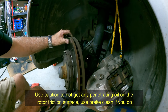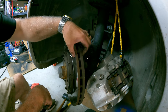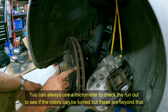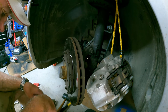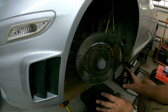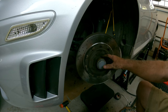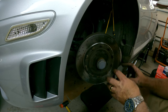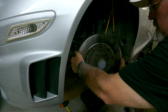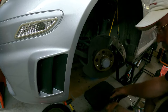The upside is the bearings and everything else feel good, so that part's not a problem. But there's a pretty good lip on both sides of that rotor, and that's how you can tell that it's really worn. If you can hook a fingernail over it like that, it needs to be replaced. Let me get this wire brushed and then we'll come back to it. I went ahead and wire brushed it, and because I'm not reusing this rotor I went ahead and put a little bit of WD-40, just enough to penetrate a little bit and help lubricate that rust. Smacked it real good with a hammer and it popped loose. So there's the rotor off.